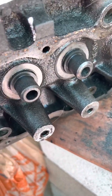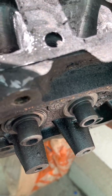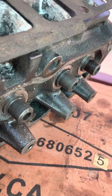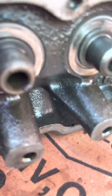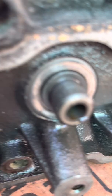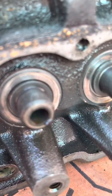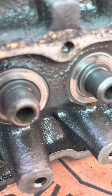And the valve guides. It already has replacement guides, it looks like, sleeved guides, so I'll punch those out and put new ones in that have the right diameter for the new valves. They'll be standard diameter. If valves are worn, you can use them again if they're polished, and they put sleeves in those guides with a smaller diameter, by about 1 to 3 thousandths, whatever the wear of the valve is. You can sleeve that hole so the clearance is correct for the worn valve. But since there'll be new valves, those will just punch out, and then it'll get standard sleeves. It looks like the original cast iron hole bore was worn out, and they sleeved them. So those will come out, with new standard size sleeves for regular standard valves, without oversized.